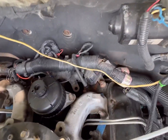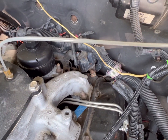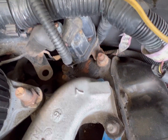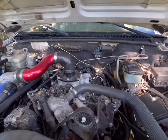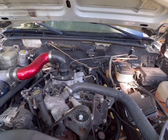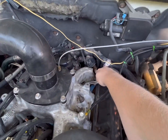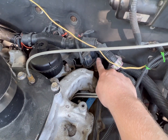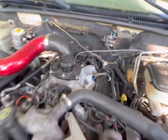Next, we'll talk about your glow plug relay. If it's not grounded properly to that little water jacket cover right there, you can have a flicker effect. Your glow plugs come on and go off, you'll have issues with them staying on, and you'll have problems with them triggering randomly if you hit a bump. Make sure that's snug and clean right at that surface. If you find yourself having problems with the relay, just run a ground from this stud up to the intake stud, and that should take care of your grounding issues there.